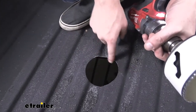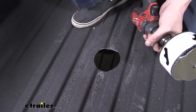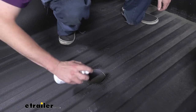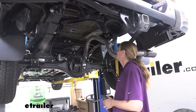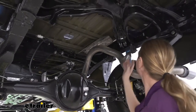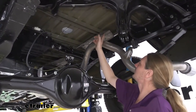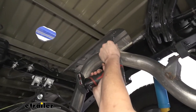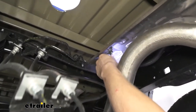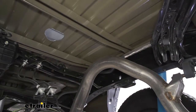Now that we've got that cut out, we can take some clear coat and spray it on to clean it up. I'm going to use a vacuum first to get rid of all the shavings before putting the clear coat on. We're now underneath our vehicle where we need to remove a heat shield. A lot of the work from now on is going to be underneath. We're on a lift, but if you're working at home you can jack it up by the frame and support it with jack stands. The heat shield is held on by two bolts that we'll remove using a 10-millimeter socket.